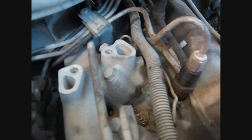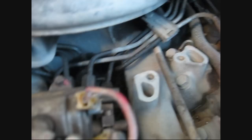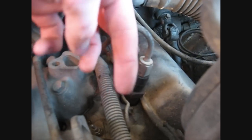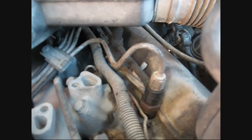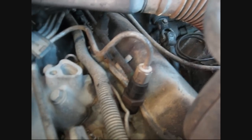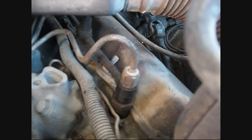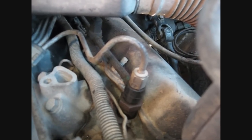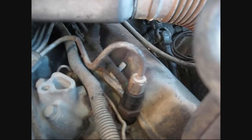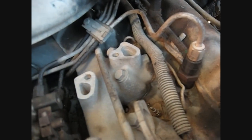If you are having fuel problems and you've found that you are getting air into your lines — which is probably why it's dying after starting, or you can't get it to start at all — what you might try doing is loosening these lines. Loosen them — I would only loosen half of them at a time — and just crack them open and crank until you get fuel running out of the line. Then once you do get that, tighten the lines back up and it should start off the ones you just did. Then crack the other ones and let it run while bleeding the others. That way you're not killing your batteries so much. You can even tighten them back up while it's running.